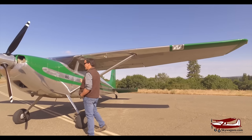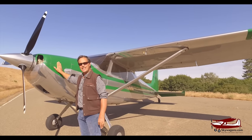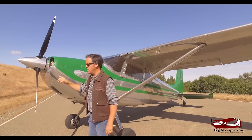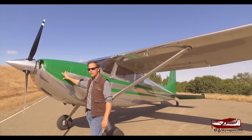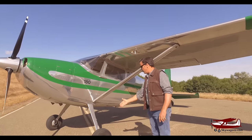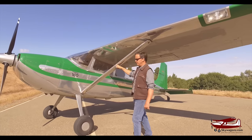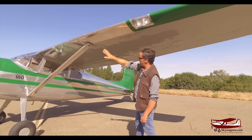It's a '53 and it's been modified and upgraded, because in 67 years there's a lot of stuff you can do. It does not have the O470A in it — the original engine with the two-blade, big-blade clamped Hartzell with the ADs on it. If it's an A, walk away; if it's a J, it's okay. Well, this isn't even a J — this has got an IO470, fuel-injected 470 engine at 260 horsepower, not 230, and a three-blade on it. So it's a really nice combo. It's got upgraded gear legs, not the thin gear legs that were originally on it. It's polished aluminum — the bottoms of the wings aren't polished because it's so hard to detail them, but the leading edges are polished and the fuselage is all bare metal.